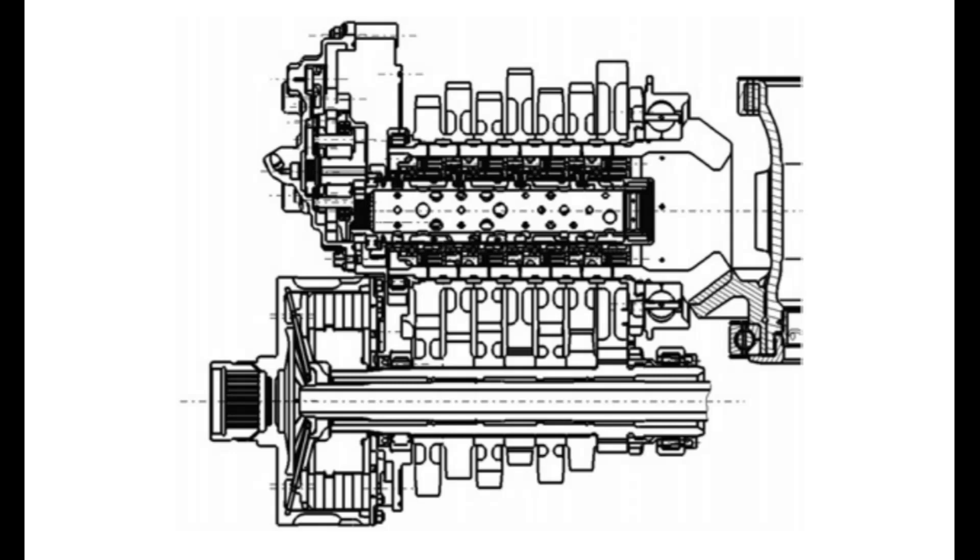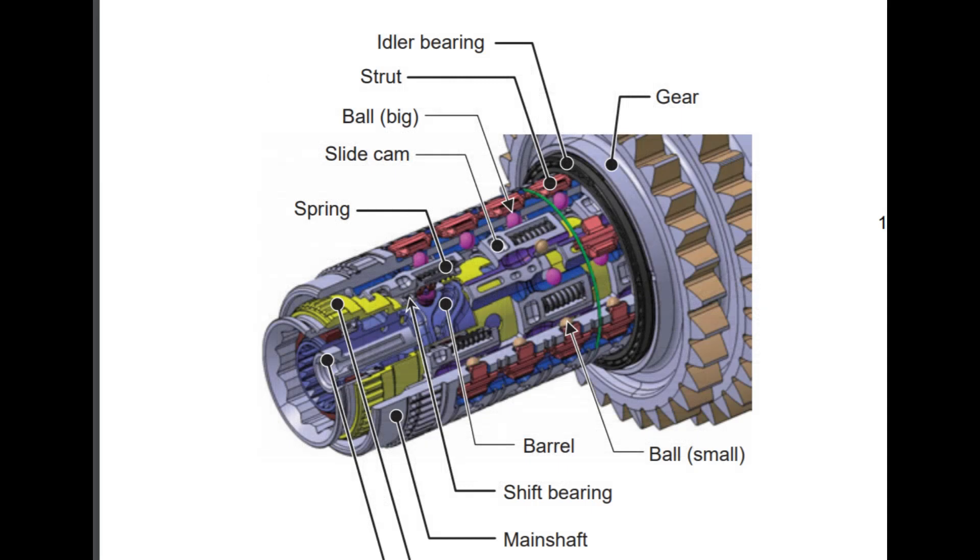My theory is that there are a couple of things. The hybrid era regulations around the number of gearboxes are much more stringent, so I'm curious whether that type of design just didn't work out from a durability standpoint. Also, now we have much larger turbos feeding a lot more torque through this gearbox. The V8 era gearbox had very low torque — I think somewhere actually under 300 pound-feet of torque coming out of that entire engine, even though it was making 700-800 horsepower. This hybrid era, I believe they're well over 500-600 pound-feet of torque. So the shift fork is this actual piece here, and it's going to actually extend up to this piece here.